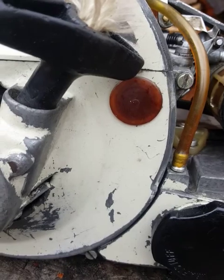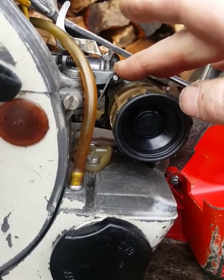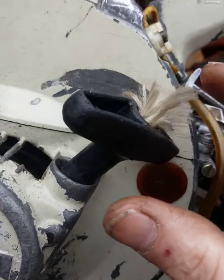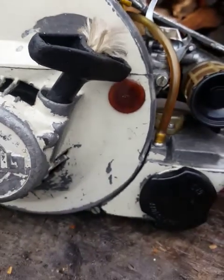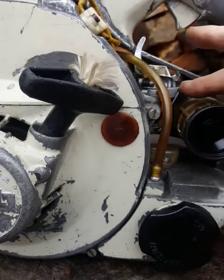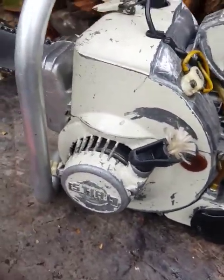When you hold these saws at full throttle, it almost feels like they're missing, and then they're going up and down, up and down, up and down. And if you start them and run them, you'll actually see the choke lever almost bouncing, and that's because inside here, this little plastic cap, there's the flywheel governor, and it has a tension spring on some little teeth on a little crescent shaped lever, and you can adjust the resistance that the spring applies to the little vane, which moves up and down. So as the revs increase, the pressure on the vane increases, and as it lifts the vane, it actuates the throttle linkage to help restrict and control the engine revs. And so you can adjust the tension of the spring for the type of cutting you're doing. And all the way around.